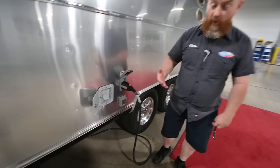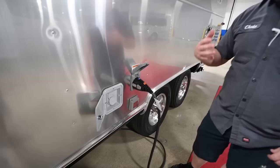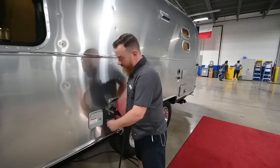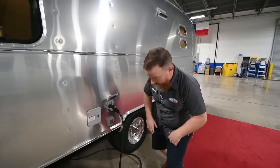Next, we've got the fill port for the onboard fresh tank. When you're bringing water with you, add it through this port. This trailer has the tank monitor in the bathroom — when we get around back I'll show you how to set it up to watch the status of your tanks. If you overfill the fresh tank, it will come out of the vent port next to the fill port and not inside the trailer. I recommend you cycle through the water in your fresh tank every two weeks to 30 days. After two weeks the water will start to taste a bit stale, and after about 30 days — especially in the heat — it will start to stink.